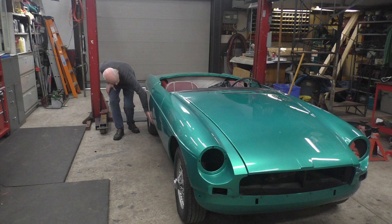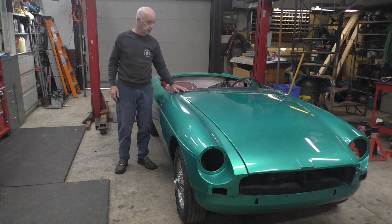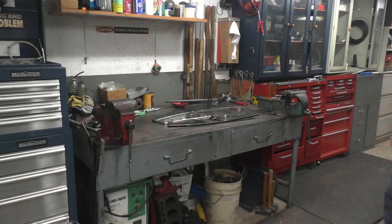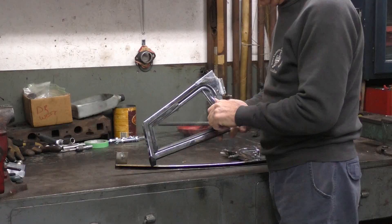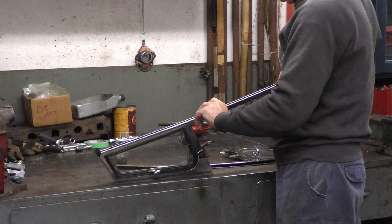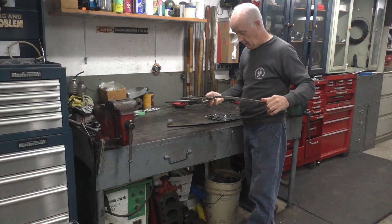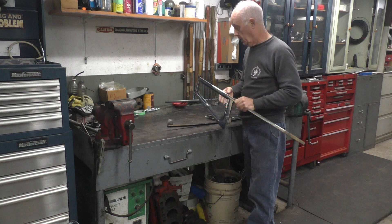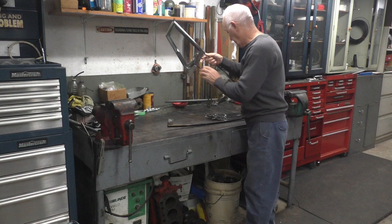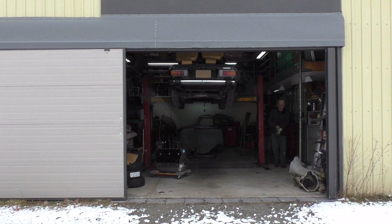All the car's finished really well and my door gaps are good. So all I have to do now is put it together, which is what I'm going to do. I kind of started already because I started on the side windows - on the quarter windows we've repaired them already. With the quarter lights, I've replaced the rubber right in the quarter lights, put new rubbers in here, and we've also put new strips down here - the runners for the windows to go in. We've made sure the nuts on the bottom are okay, the tension's good on the spring, and the unit's pretty clean. We've put a new rubber in the top as well. I'm going to put these in the car - I've got the seals to go underneath, all the seals in the door. Thanks for watching and please subscribe to our channel as we appreciate the support and it encourages us to make more videos.